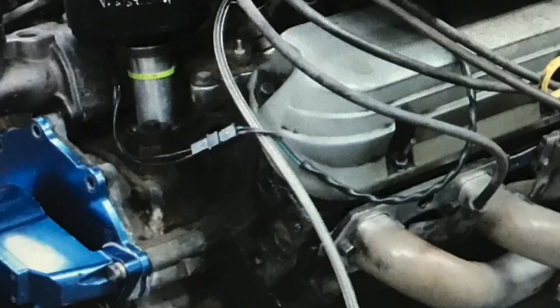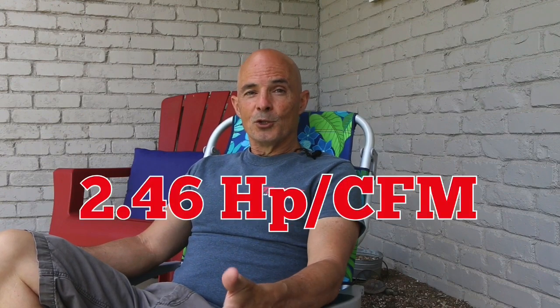Here's why that formula isn't absolute. We've made more than that number — generally it's less, but we have made more. For instance, we did a test with a stock 5-liter Ford cylinder head and put it on a 392-inch stroker with lots of camshaft, and we were able to make 2.1, 2.2, even 2.3 horsepower per CFM. On a 400 CFM head making 800 horsepower, that's 2 horsepower per CFM. There are guys probably making more than that.